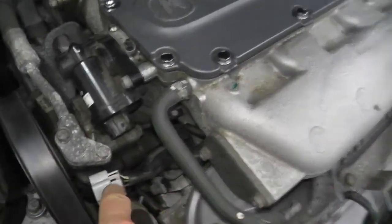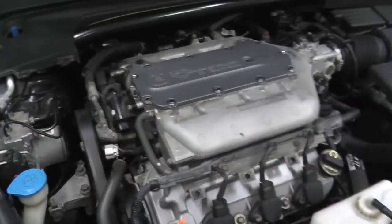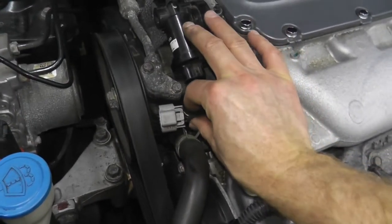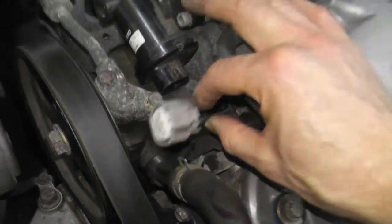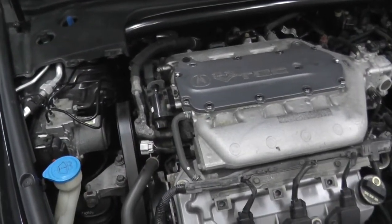In some vehicles, you may even see a 12-volt reading — that is also fine, that is battery voltage. The point is you want to verify this is getting power. If it is not, check right at this location. What happens over time, especially if your vehicle is old, is that techs working on the vehicle pull from this location and dislodge the prongs inside the harness connector. That's most likely your bad connection at that point.